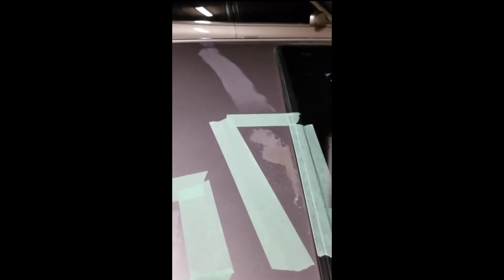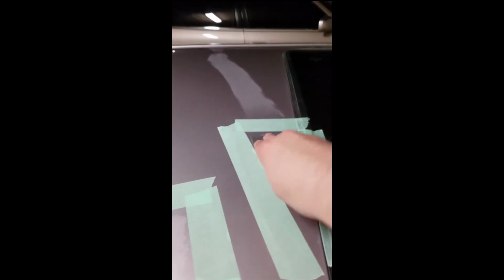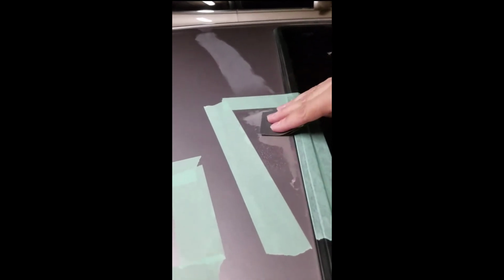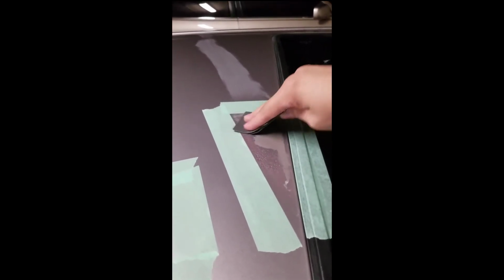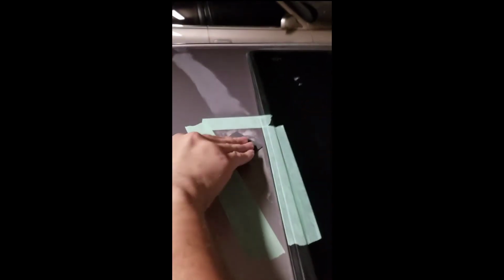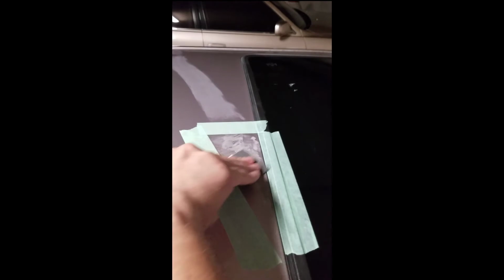So hey guys, real quick, my little procedure is to wet down the area and then start sanding it in one direction and then hit it in another direction, so that you're eliminating some of those peaks, so that when it comes down to polish, it becomes a little bit easier for you. So I'm gonna finish this up real quick, and I'll get to the polishing right after.